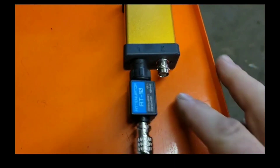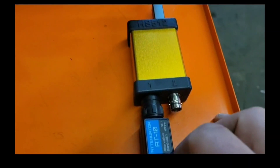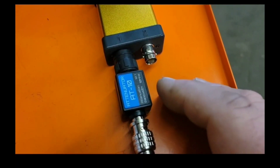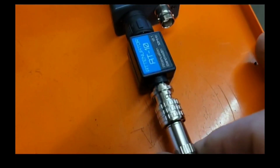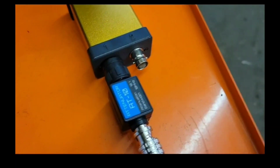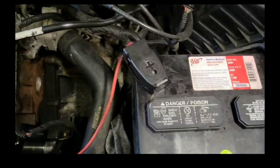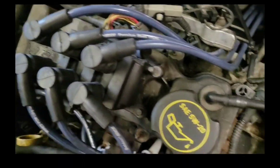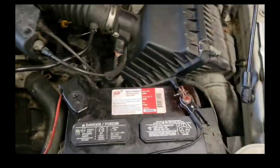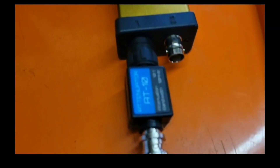Alright, shut the car off and I'll show you a picture of the attenuator that you need. This is what the attenuator looks like. If you do order one from Martin Lorne, what he said on the Telegram group is he's making these with the EMI interference protection built in. All I did was put the attenuator in between. I had a bunch of Hantek attenuators anyway, but I ordered his whole set and this solved the problem. He also recommended going to the battery — it was dropping out. I actually moved it closer to the block, but as you go closer to the source of the interference it gets worse. I was making it actually worse by moving it closer to the coil pack. But in the end, there's great support for these things and it's that simple.